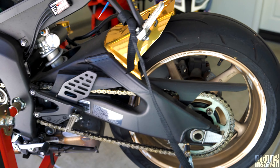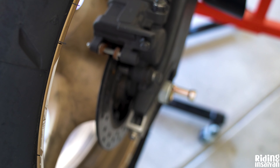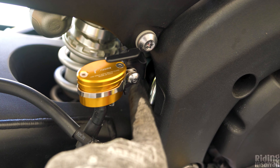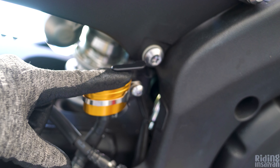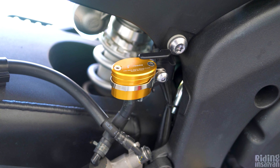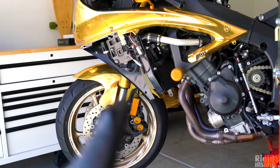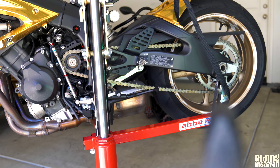We're going to be removing the brake pads — we still have the OEM ones so we need new brake pads, also coming in the mail. We're going to clean the rotors, clean the brake disc, remove and clean the calipers. I need a scissor tool to cut the excess off because the OEM rear reservoir was big enough to fill that space but the aftermarket one is much smaller. So all brake fluid gets removed and bled out, new brake lines go in, new brake pads — two pairs in the front and one pair in the back.